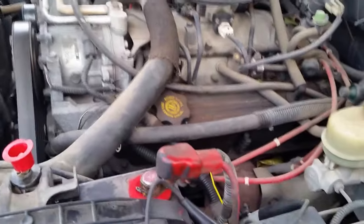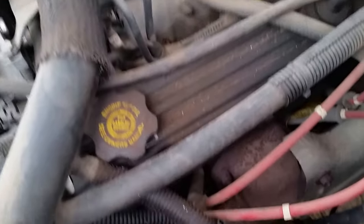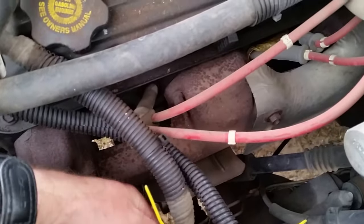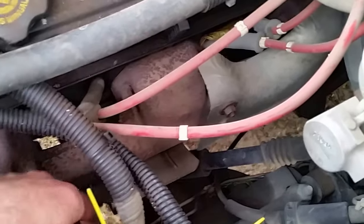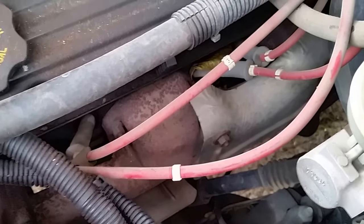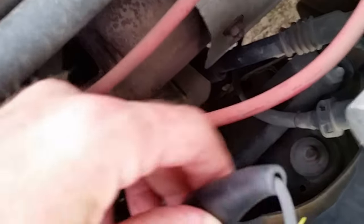As a potential way to work around that — off the starter you've got the plus wire, the positive wire off your battery, which heads down to the direct starter connection. But there's also a start ignition signal wire that comes out of there. I traced it back up, and it comes out right here. These two gray connectors normally are connected together, you see that there.